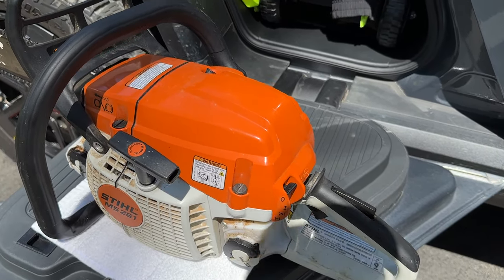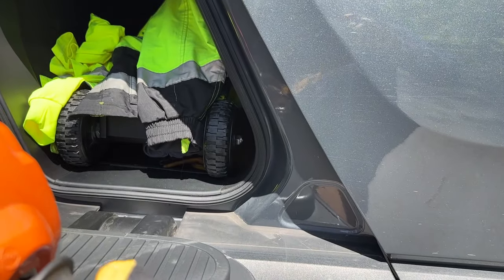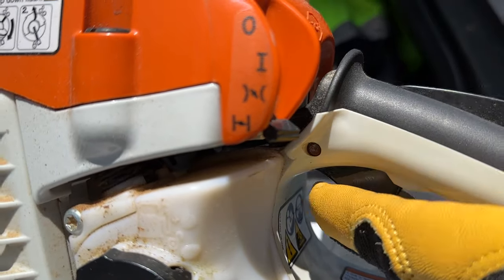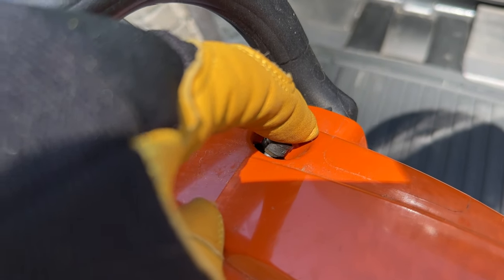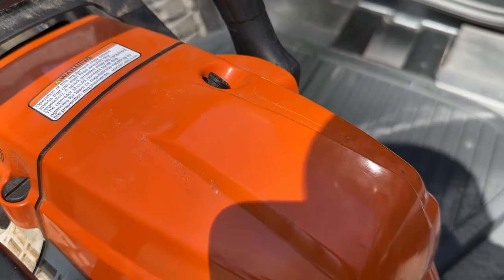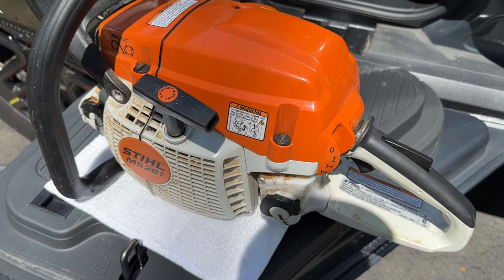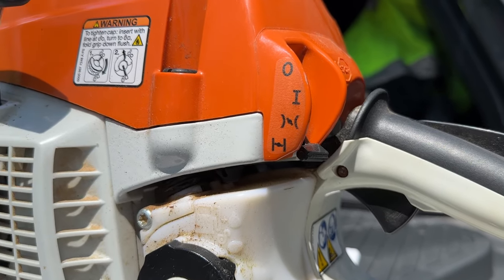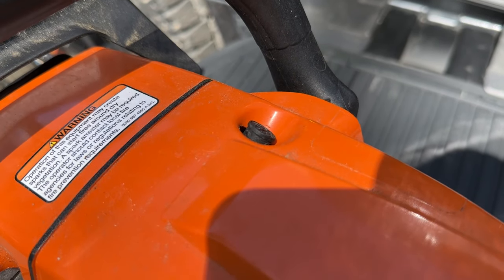Here's how simple it goes. There are four settings here on the choke. You want to go all the way down — of course you have to press this first — all the way to the bottom as step one. Then you want to make sure that you actually depress this one here so that it's on the inside. And then as you start cranking, make sure to only crank in this bottom choke position, only until this pops out again.